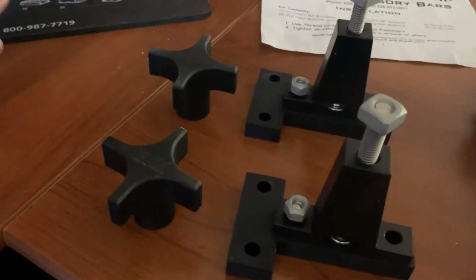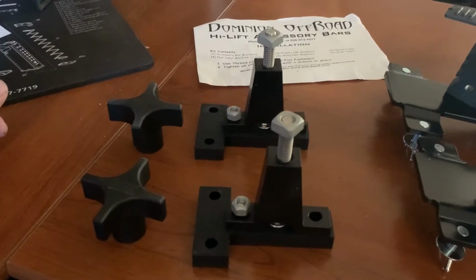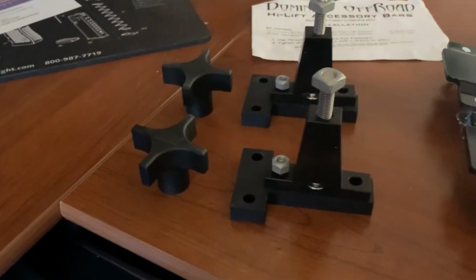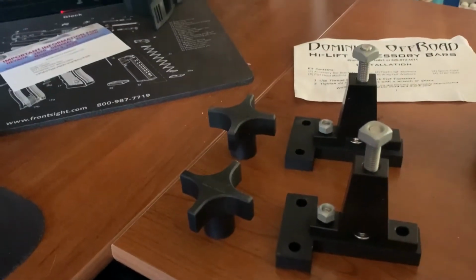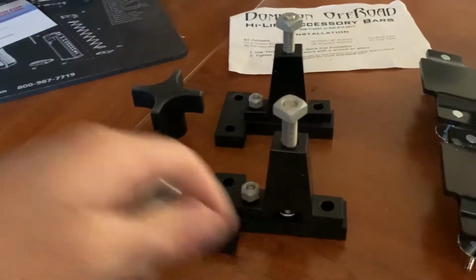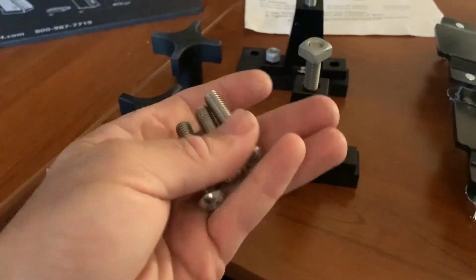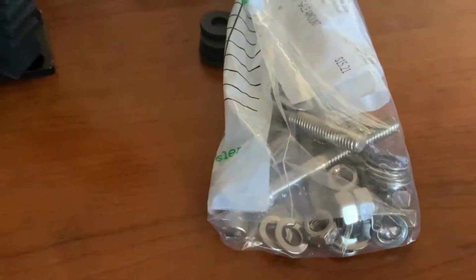So based on a 4Runner install on the factory roof rack, I found a guy who did it online, and he posted a few photos, and I followed that. I'm finally getting around to doing it. The first thing you have to do is order, I think, the TJ Jeep Wrangler TJ hood rack kit. These normally would just bolt straight into the hood where they already have threaded holes. They give you the screws, and obviously no bolts, because they go right into the hood's threaded hole. So you'll have to get new hardware, which I got, which is basically just longer bolts with some washers, lock washers and nuts.